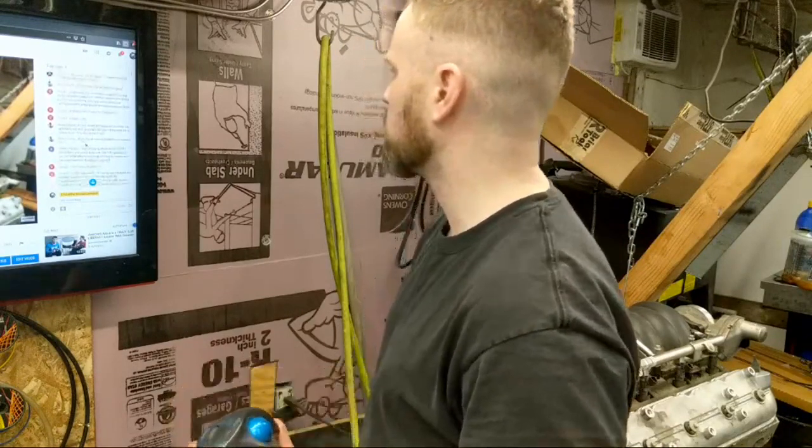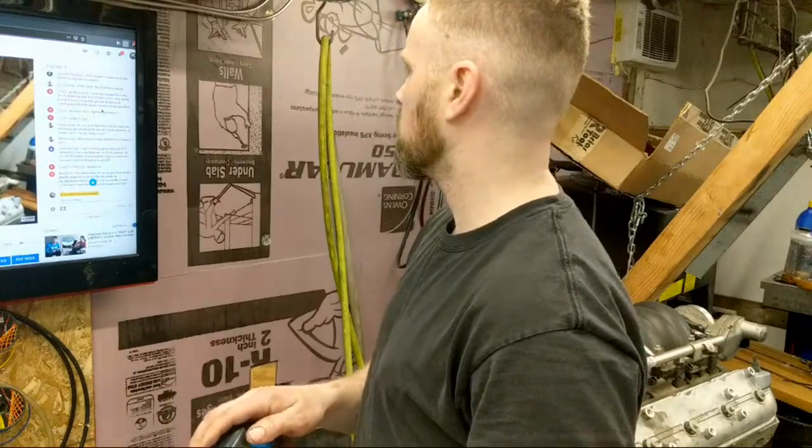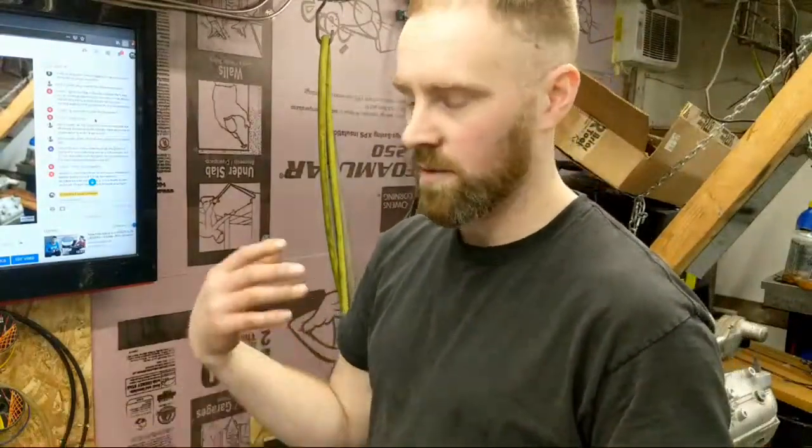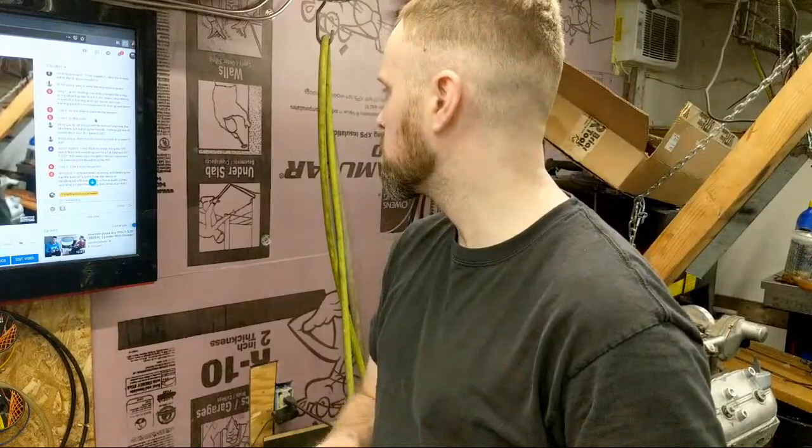Okay, so you changed the O-ring. It's fluctuating, and he's wondering if it's going to be the sensor. It very well could be the sensor. The sensors on these things are just kind of pieces of crap. They fail pretty often. That's why I always pull the cover off the back of the intake when I service these things. Whenever I have the intake off, I pull that cover off, throw it in the trash because it makes the sensor a lot easier to work on. So it's very, very possible. But make sure you check the screen in the sump and make sure that's not plugged up because that will cause bad oil pressure readings as well.